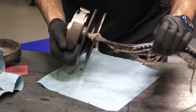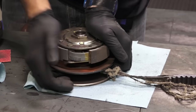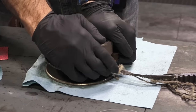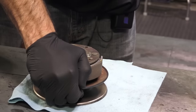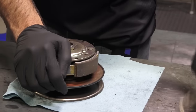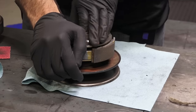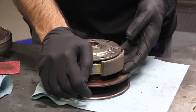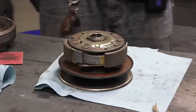To release the clutch, put your palms on it like a little steering wheel and turn clockwise. The belt was stuck in there but I just pulled it right out. I'm going to take this all the way apart to make sure there's no belt filament stuck in the driven pulley seals. A lot of people just replace the belt after a break without checking, and then suddenly grease contaminates the clutch and the new belt — so I'll show you what to look for and what needs to be changed out.